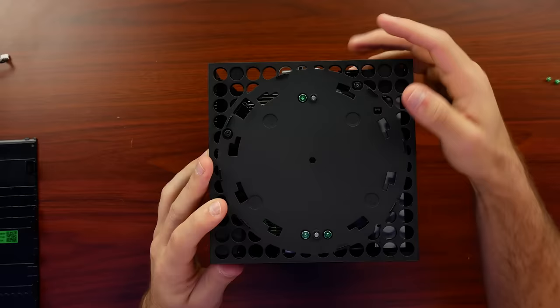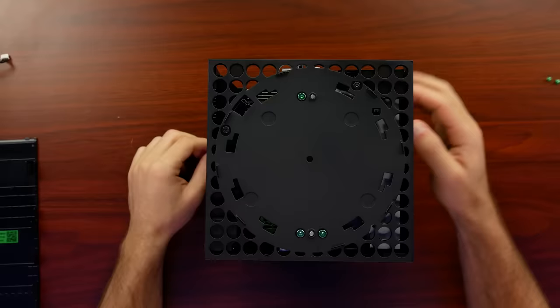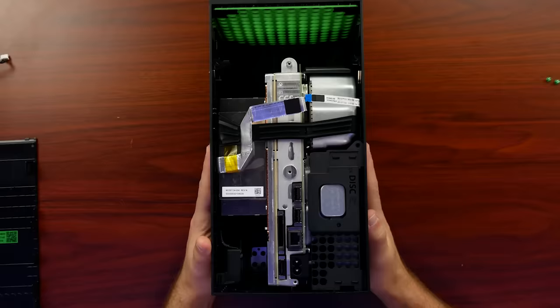Once you do have this bottom piece off, we can see some screws here, here, here, and here. Those are just holding on the plastics and that center piece — basically everything keeping all the rest of this stuff in place. With all the screws removed, this piece will pop out, and then we have this piece that is mostly there as a safeguard to help hold the SATA and power cable down to the disk drive, which is now free.